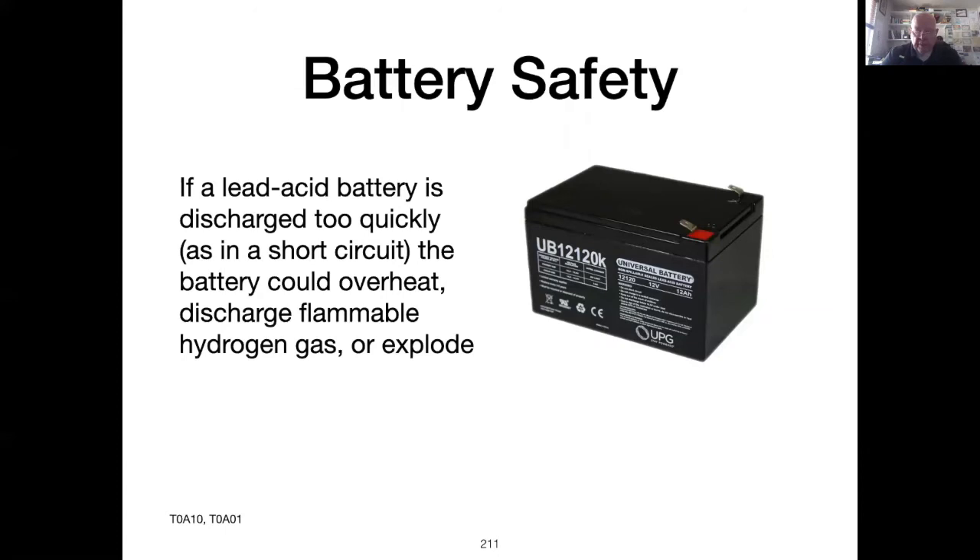If you have a lead-acid battery in your car — many hams use similar batteries in their portable operations — if the terminals of a lead-acid battery are shorted together, the battery will give up all of its energy right now, in milliseconds, all of it. The battery, depending on the size, may overheat and catch fire. It will definitely emit hydrogen gas, which is flammable, and it may explode. Take care with batteries to be certain the terminals can't be accidentally shorted by dropping a wrench, a piece of wire, or some other circumstance.